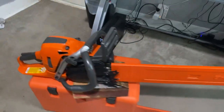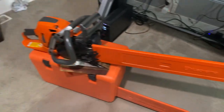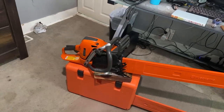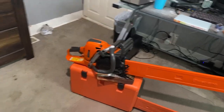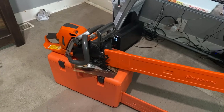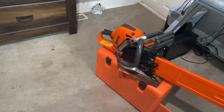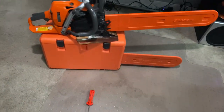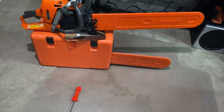Don't forget to like and subscribe for more content. I'm going to be doing an auto tune reset with this 562 XP, as well as a muffler mod part two that everyone's been asking about. There's very little information on the muffler for this saw — what the inside looks like — there's really not much on the internet. I saw a gentleman who did a video and he cut the baffle out, which I didn't realize the baffle was that big. The muffler is more restricted stock in the 562 XP than the 550 Mark II — flows a lot better and has a bigger outlet, as I'll show in some pictures on the channel coming up soon.